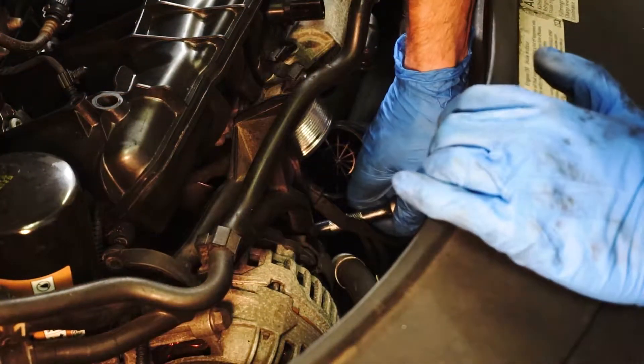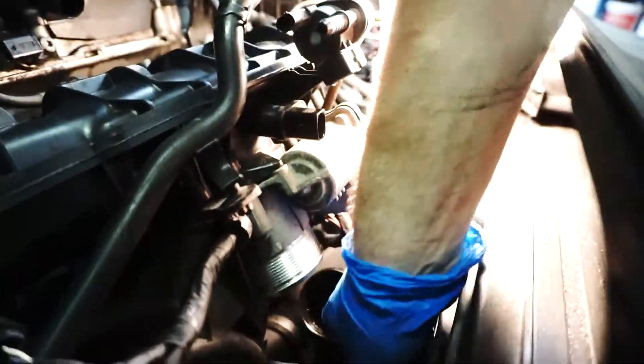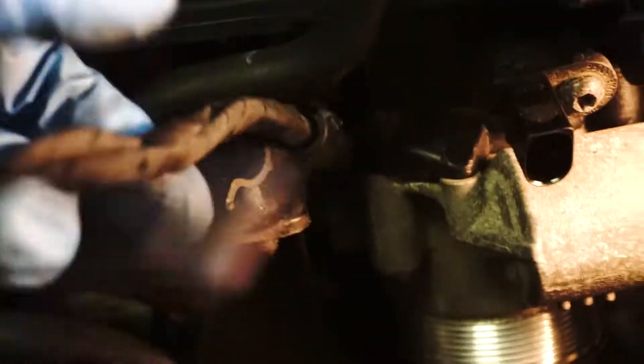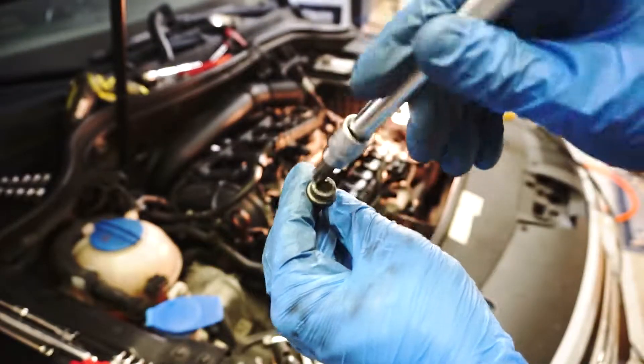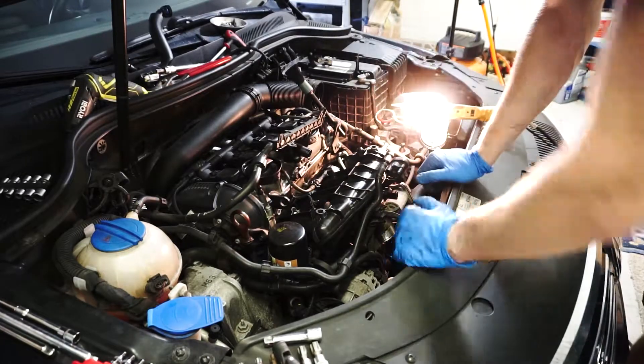That bolt is T50. By some angle you can probably see it — I'll try to show it on camera. I already unscrewed it, but I want to show you the angle I'm using with the socket — it's almost straight from the radiator fans with a little angle. It's pretty hard to fish it, so check from different perspectives. If you're looking from the front of the car, check the place between the throttle body and the bracket. Move that wire with the bunch of connectors to the side, shine some light in there, and you'll find the bolt. It's an M-type but T50 fits just fine. We can easily move the intake manifold, but we still have to do the gas line.